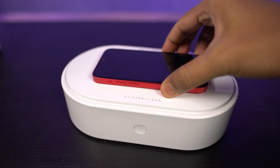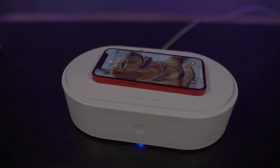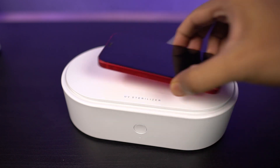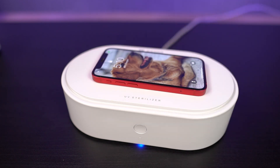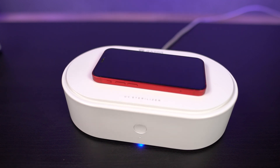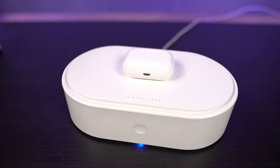As for wireless charging, you just need to place any compatible phone or device that supports wireless charging at the center of the box to start the wireless charging. There are 4 different charging modes. If you're using an Android phone, you can get a maximum of 10W. For iPhones, it's 7.5W. For any other Qi enabled devices, you can get up to a maximum of 5W. And for AirPods and Galaxy Buds, we get up to 2.5W. For the best charging speeds, I would suggest you to use a quick charger with at least a minimum output of 15W.